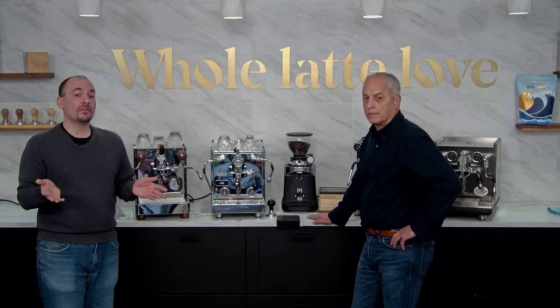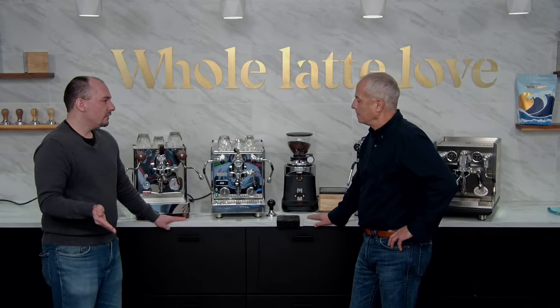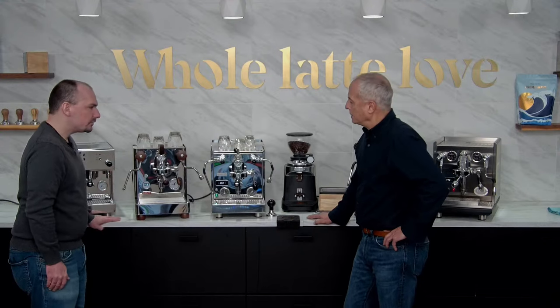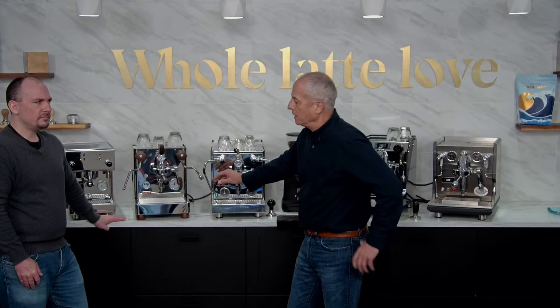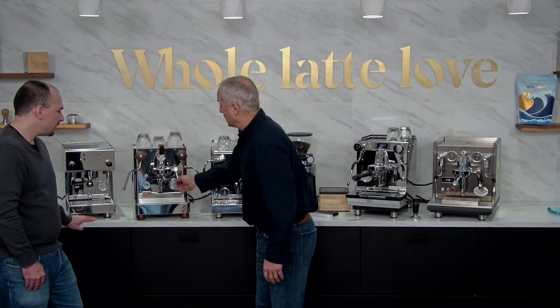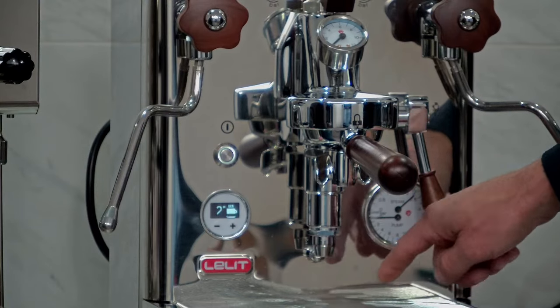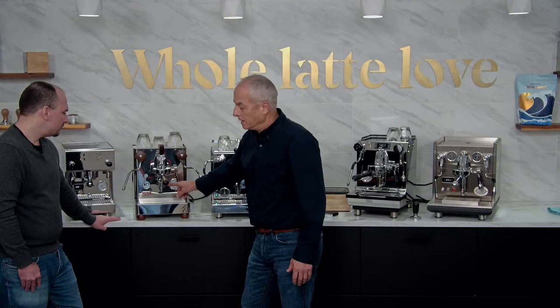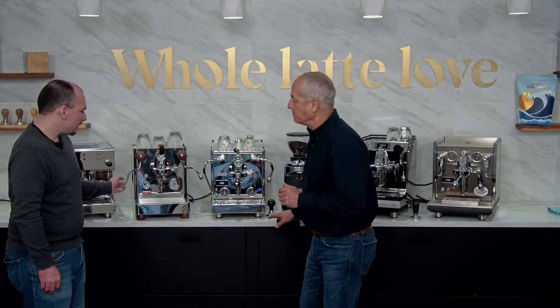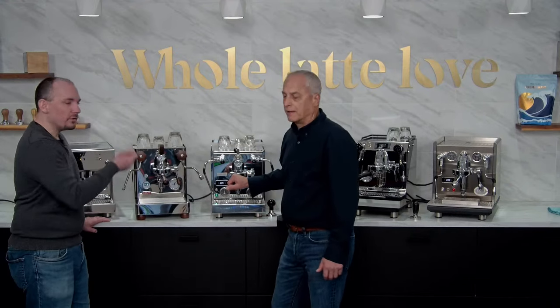You can turn the steam boiler off and switch between Celsius and Fahrenheit. For pre-infusion, I programmed five seconds on and five seconds off — lift the lever and water flows for five seconds, then it stops, waits another five seconds, and kicks on again. That's pre-infusion. With all E61 machines, you raise the lever to turn the pump on, and lower it when done. The Pro 300 has a three-way solenoid valve while the lever controls the valve here, with a micro switch for the pump that activates when the lever is raised.